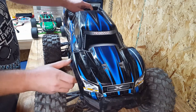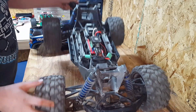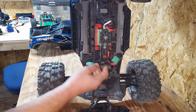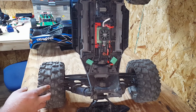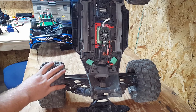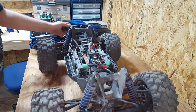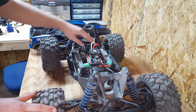I have done a few modifications to it. I have the Castle XL2 ESC, and I put Castle 6.5mm bullet plugs on it. I have the Castle dual fan upgrade — that's actually for the 1/5th scale Castle motor for the HPI Baja. I just cut the sides of it off and zip-tied it to the upper chassis brace.